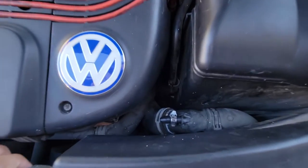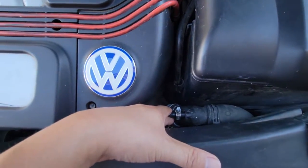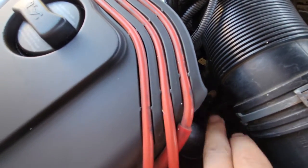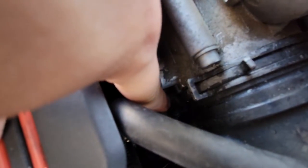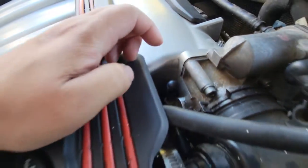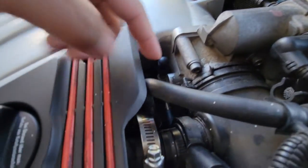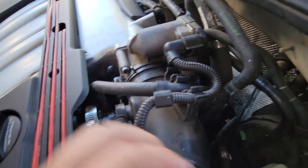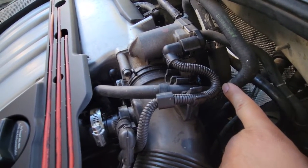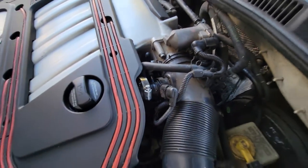Here's a quick summary of what I did. I removed the heater hose that goes from the plastic pipe to the metal pipe here and capped that off. Next I removed the heater hose from this end of the metal pipe that goes into the bottom of the throttle body and capped that off. Then I removed the little triple-split heater hose area that goes from the top of the throttle body into another heater hose set. I was able to find a hose from an old stash that fit from this triple-T heater pipe into the one down there.